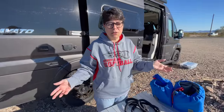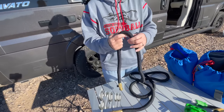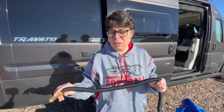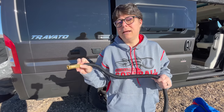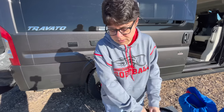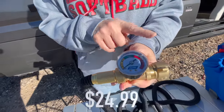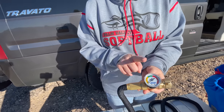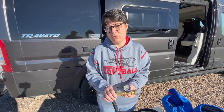You also need a way to hook up to water if you're someplace that has water available. We got one of these flexible retractable hoses — I'm sure they have a wonderful technical name. This is so much easier than the hard plastic white hose that comes with your van or that you can buy cheaply at the home improvement store. The other thing you'll want is a water pressure valve that you connect to the water source so you're not running at too high a pressure and blowing out the lines in your van or RV. Get a water pressure gauge as well.